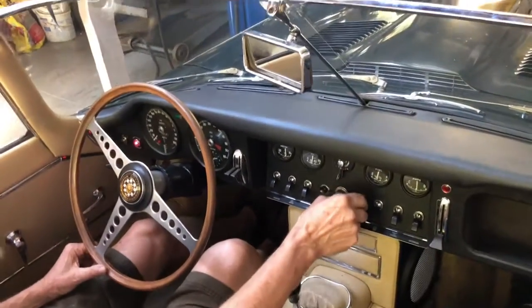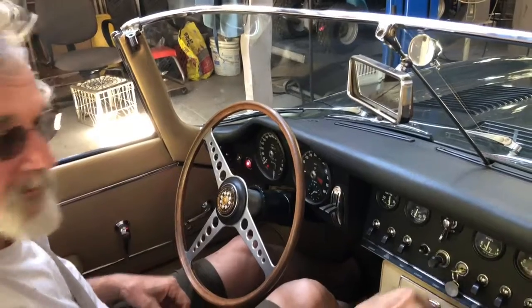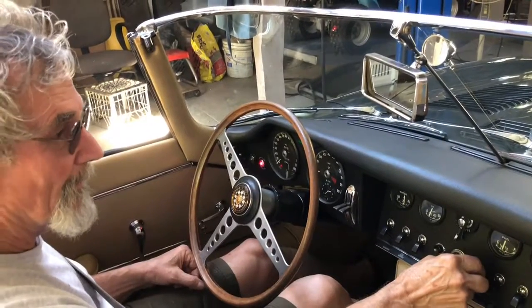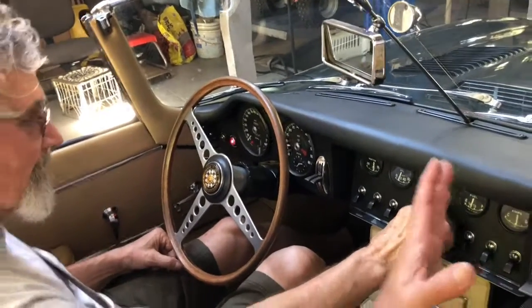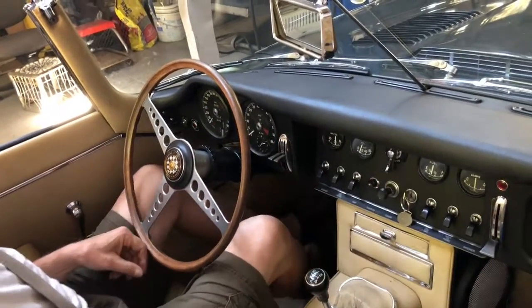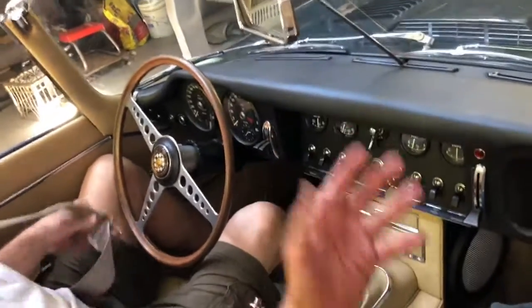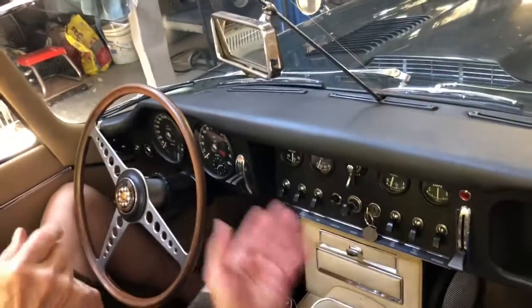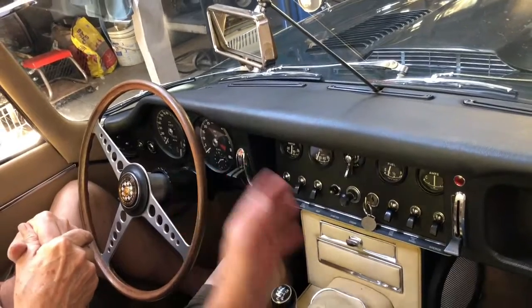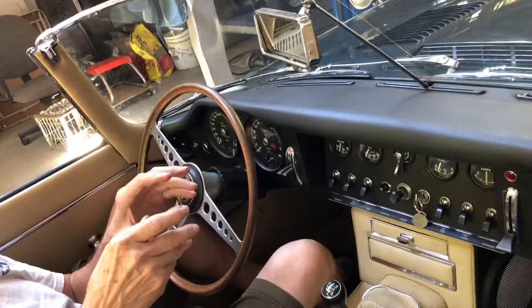I'm thinking the same thing you're thinking, a little bit of a tie-in, a little carb thing. Yeah. But boy, that thing just, what it feels to me is it might not have enough advance. Because it hits that wall like you described, when you're running along, when it hits about 4,000 RPM, it just runs out. Right. And it feels like it's not getting the advance to pull it up further. So, okay, but that should be fully advanced by 3,500. So you're thinking at that point a little bit more advance, maybe, to get a little more advance.